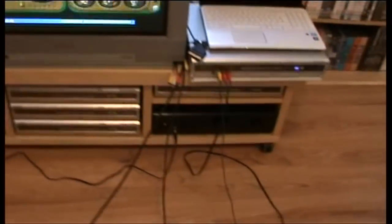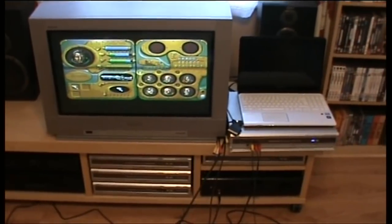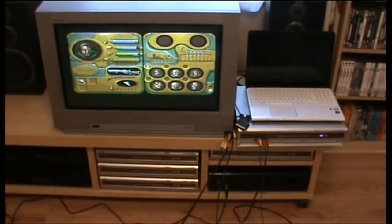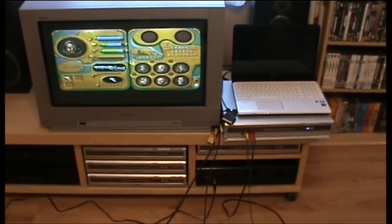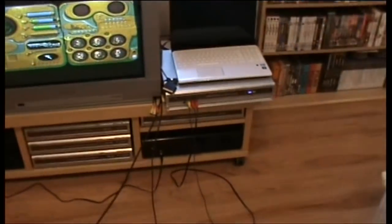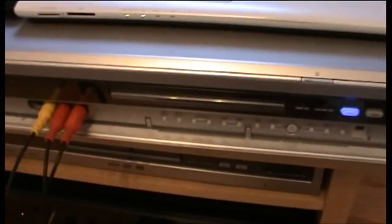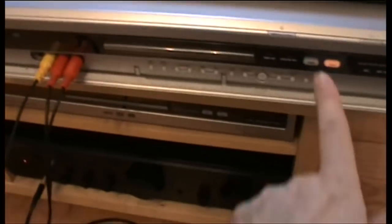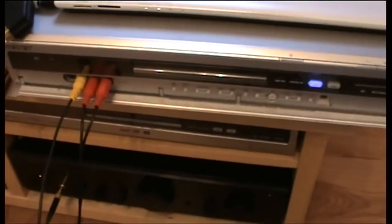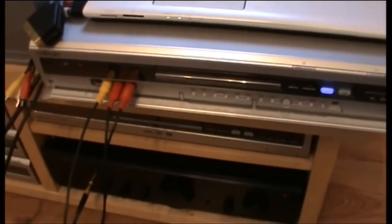The RDR HXD 870 — it's two generations younger, a bit prettier than mine — records three color systems: PAL, NTSC, and PAL60. It covers all grounds. On eBay you can pick them up anywhere between 50 and 120 pounds. The most important thing is it accepts RGB. Also, this particular model and the 870 both record on double layer dual layer discs — giving you almost twice the amount of content on disc without lowering quality.